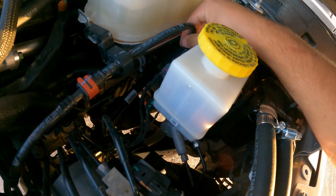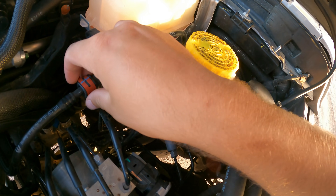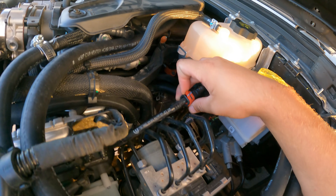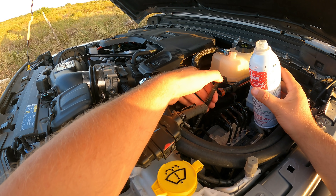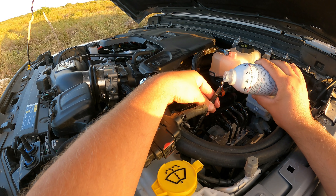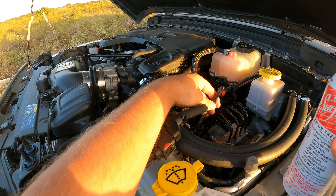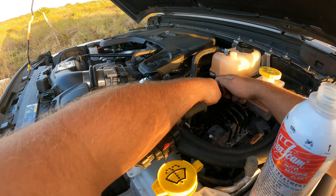The vacuum system on the JTs and JLs looks a little different — there's like a crimped connection down here on the brake hose assembly. We could pop this clip off. The preferred method on these newer vehicles is probably the aerosol spray — that's probably why they started making that kind. Let me mess with this connector and disconnect it. Same thing: fire it up and hold the RPMs. Kill it. We're going to let it sit for about ten minutes.